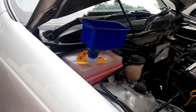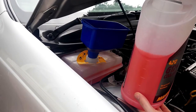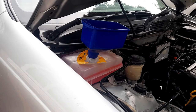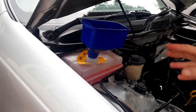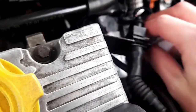Now, because it's over halfway, and I suspect, looking at this, this is where you've got to have a look. One, two, three, three and a half. Right, I would suggest we've got up to about 4 litres at the moment, and I suspect we're not far off with the system at almost full capacity. Obviously, the block will not be filled as of yet, I suspect. So, we go back to what we did before. Okay, now, this will leak coolant.